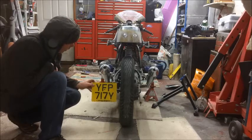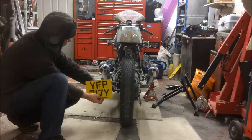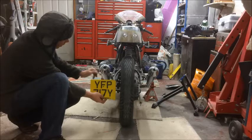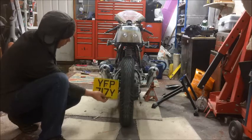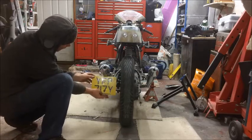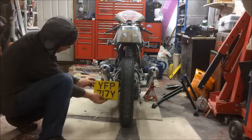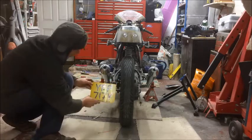I've been looking around and I think here is okay. Now I'm going to mount it to the swinging arm. I've got to be careful because the exhaust will stay still but this is going to go up and down with the suspension. So I've got to be careful we don't have it too close to the bottom of the exhaust, otherwise it's going to hit the exhaust. Bear in mind, we are going to go smaller than this number plate anyway.